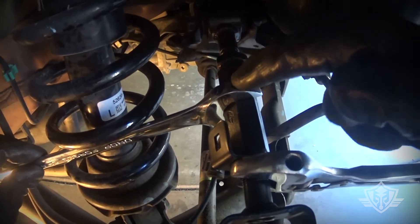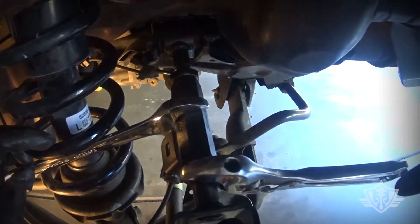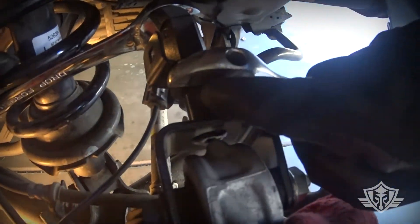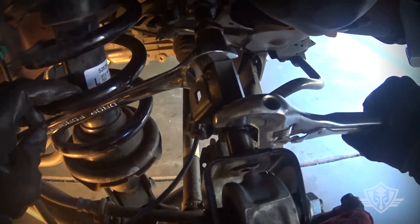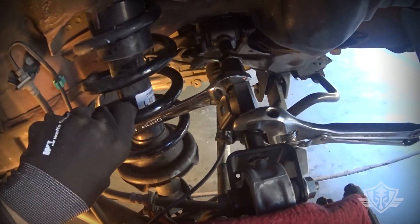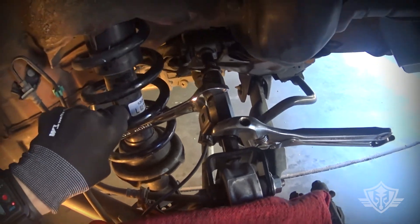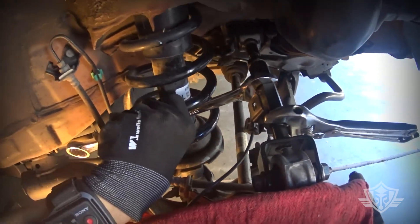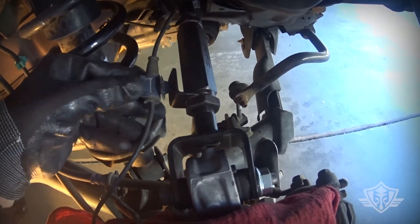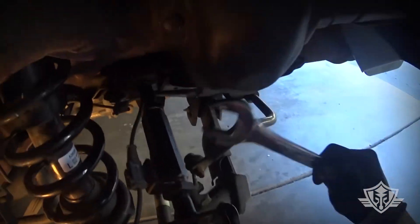What I'm using here is a one inch for this specific main central shaft to kind of hold it in place, and then I'm using my adjustable to get in there and take care of these tightened-down nuts. I unfortunately do not have a torque spec for these — I'm just going to tighten them up nice and snug because they're pretty thick, steel on steel, so it should be good to just crank them down. Once those two are tight, go ahead and pop your sensor back into position right there and make sure there's no play — this guy should not be able to move at all.